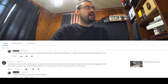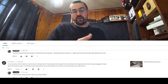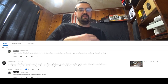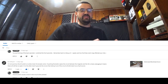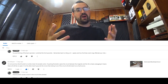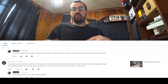Another one from Eric here. He's on a roll. He's not sure how the kill switch works, if it opens the circuit or if it closes or shorts out the circuit. And this is a legitimate question for people who are just building their first bike or not familiar with motorcycles. Even I didn't know how the kill switch worked when I built my first bike. Essentially, it shorts the circuit. It closes the circuit. So when you're not pushing it, it's open, doesn't do anything, there's no connection. That's why if you remove the kill switch wires, the motor will actually keep running. So the kill switch doesn't keep your motor running.